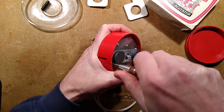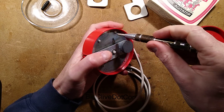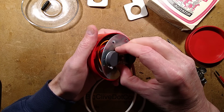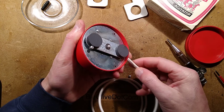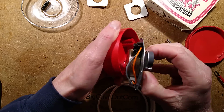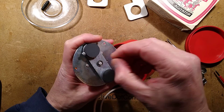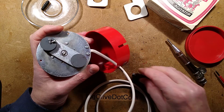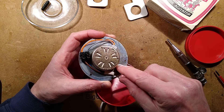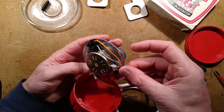The magnet is definitely wanting to be possessive about this screwdriver. Have I guessed correctly? Yes - the magnets are holding on to those screws very nicely. The flex is just fed through the hole, and there is a cable grip based on a standard grip with two holes through the metal. And here's the motor - it's a very small synchronous motor with no gearing whatsoever. It's a Crouzet motor, which is quite a posh one.